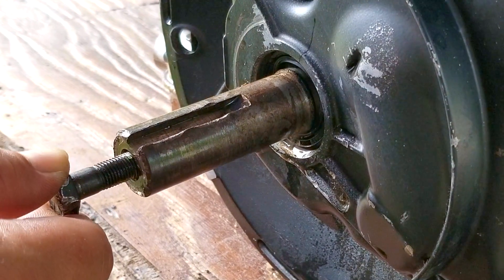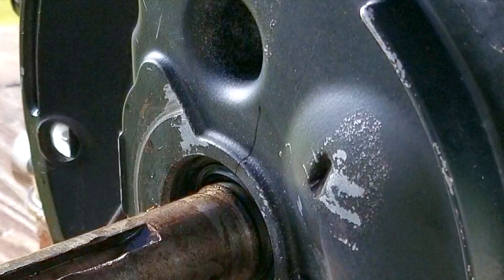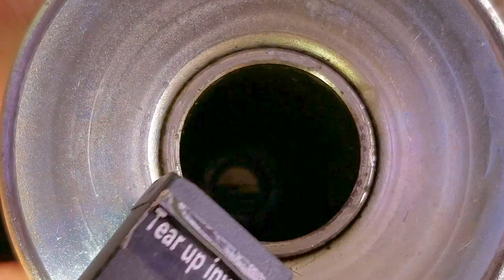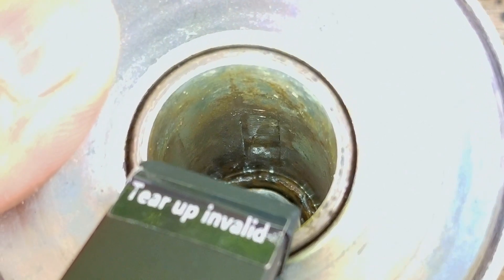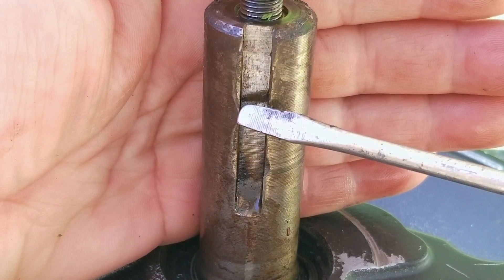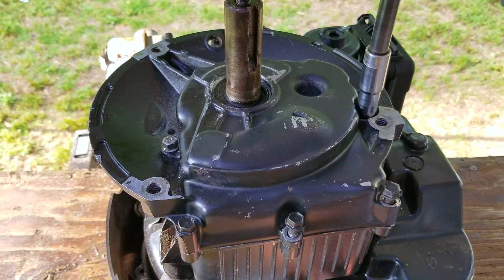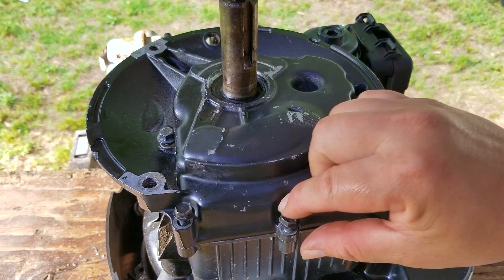With the brake off we get to see just how much play there really is in the crankshaft — and it's bad. In fact it's much worse than I could ever imagine. For this to happen, not only did the blade have to hit something really hard, they must have been running the mower at speed because this sort of damage doesn't just happen from hitting something — it had to be moving quite fast towards the object. We also have a witness to the crime: the pressed-in key on the body of the adapter. Looking on the inside where the crankshaft goes, the key does not extend into the keyway area — it's almost flush with the rest of the metal. The blade and adapter turned in relation to the crankshaft, causing the key to be pushed out of the keyway. One edge of the keyway also shows damage. This tells me something terrible happened to this engine that not only took out the blade adapter but also bent the crankshaft.